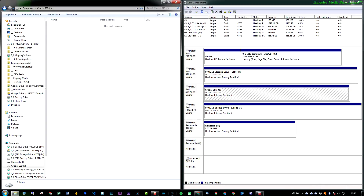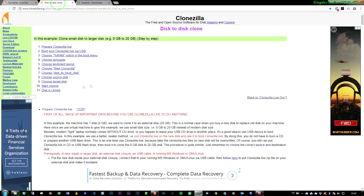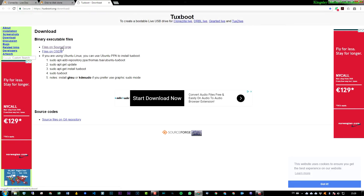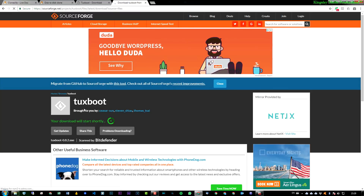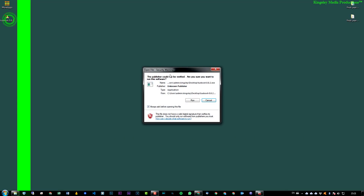Open your browser — I have two links. The first is clonezilla.org, and the Clonezilla Live documentation page shows all the functionalities: save disk image, restore disk image, and disk-to-disk clone, which is the one we need. The documentation covers all the steps I'll show you. To download Clonezilla, you use Tuxboot — click the first link, which goes to SourceForge, and simply download Tuxboot. Tuxboot supports many similar tools, but today we're using Clonezilla, so download it to the desktop.